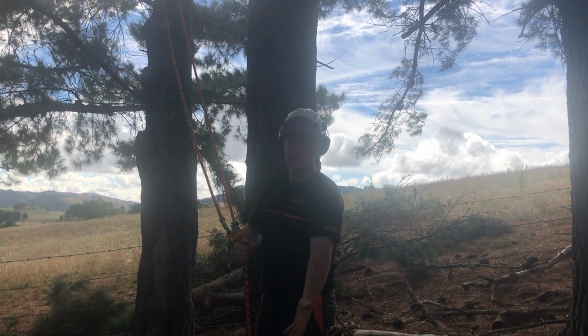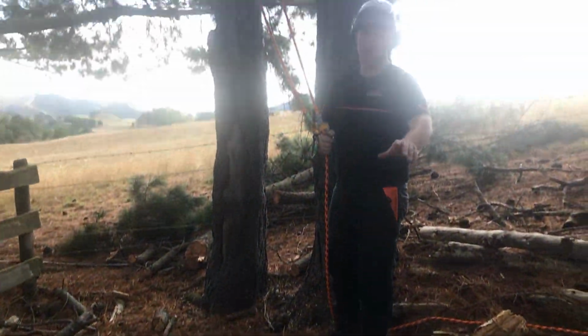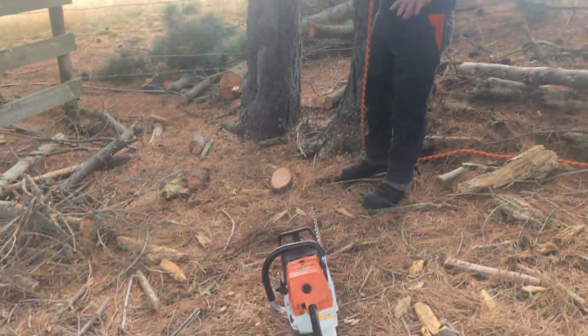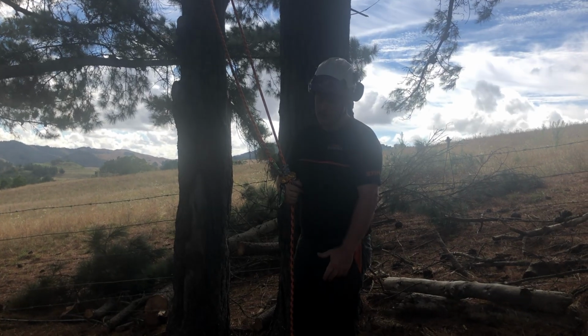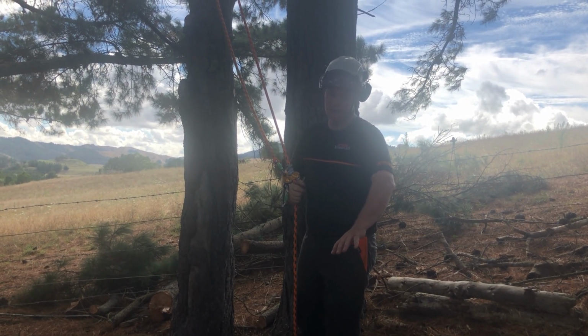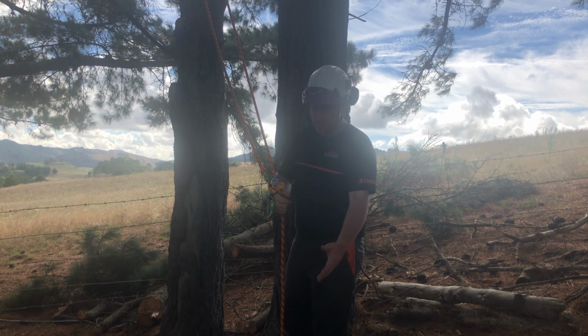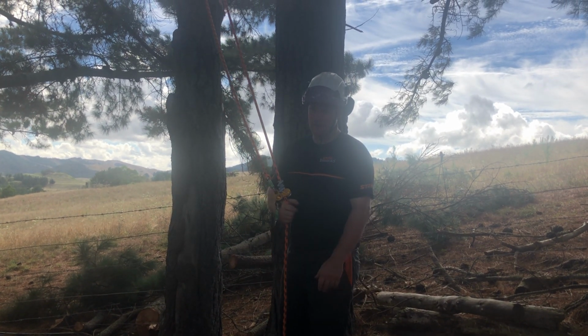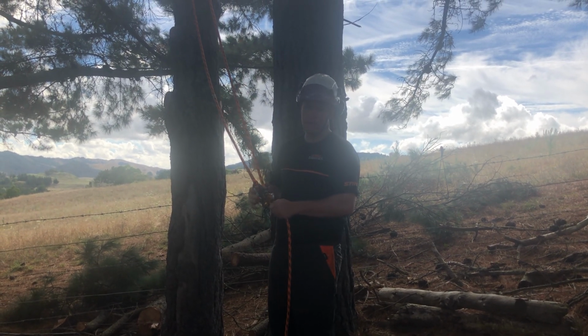I said we were going to test out Frank. You can see Frank there on the ground. I've retuned Frank, by the way, because on my video he was doing over 13,500 revs. So I've rectified that issue. I didn't catch that when I was tuning it on the video, but it's been changed anyway. So he's sitting just under 12,500 revs now, which is good for a run-in on a new engine.